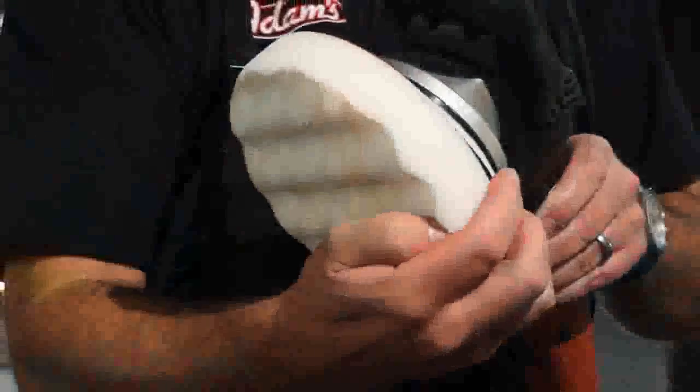Now, no matter what, when you're done using a rotary buffer, which is what that little drill is, after you're done with that, you have to follow that with an orbital polisher, because using that little pad, it's going to put little baby swirl marks in. So even though they're very small, you'll still see them and you'll notice them. So removing those is what you want to do next, and that's using the Porter cable polisher or the flex polisher, whichever tool you're using today.